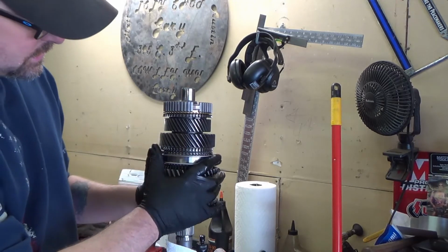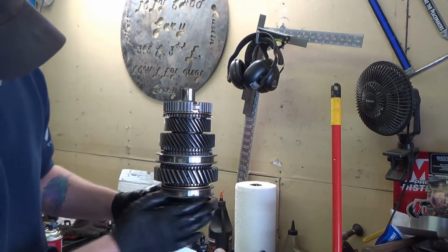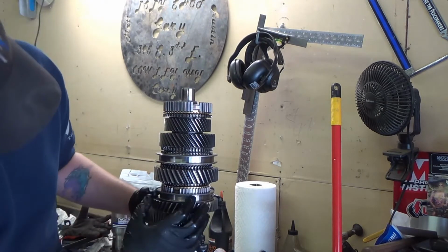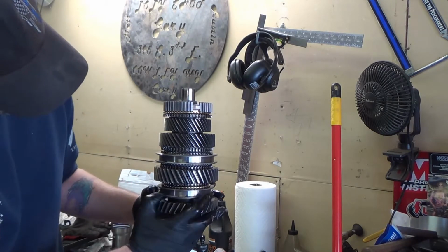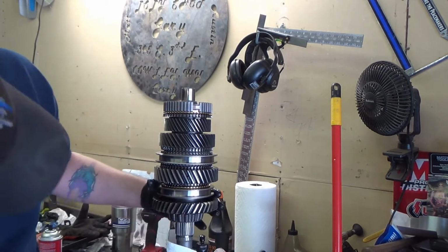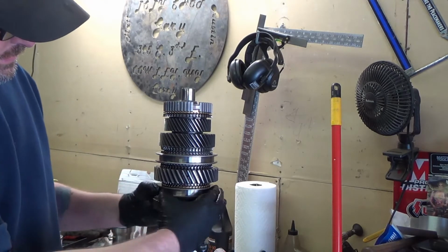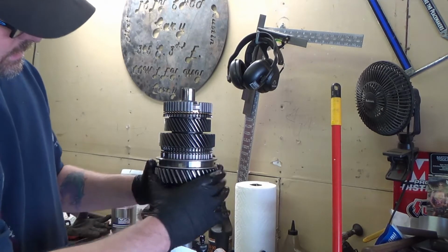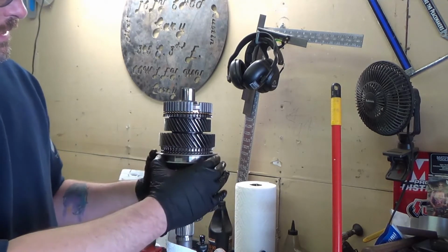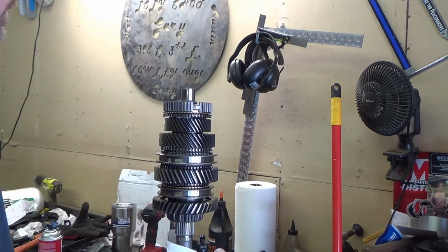now it's locked in. This synchro ring is over on the bench. I don't have it, so. And that one only goes one way. Yep, because there's only blockers on one side, so spins free. Locked in, spins free. Locked in, spins free. Locked in. This one spins free, and we don't have the hub to put on there yet, so shortly.